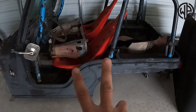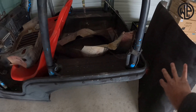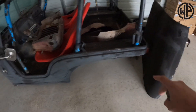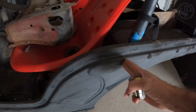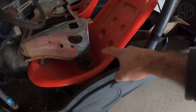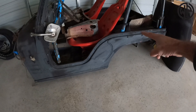Hopefully it's not too windy — we got to insulate this thing, just haven't done it yet. I think I'm going to stretch the CJ5 in two places. I think I'm going to cut the tub right here and stretch it a good four inches or so. But I'm going to start with the portion of the frame that's going to go under the tub where you sit. I'm also going to stretch this portion of the tub right across the floor, because it has no leg room. With that lack of leg room, I want to move the driver's seat back about four inches. The problem is the seat is going to be back here, which means it's going to be really hard to climb over this and drop my hips into that seat. So by stretching this back, I'm going to keep that traditional CJ5 door frame shape — it's still going to look like a CJ5, it's just going to be way more functional.